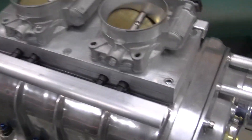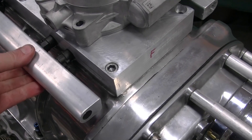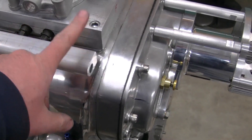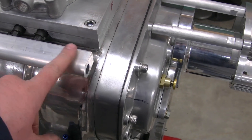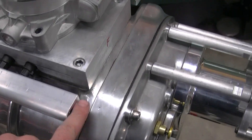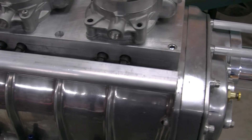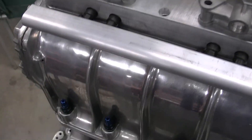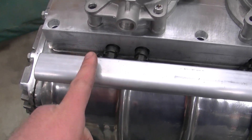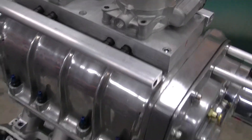There it is installed. I have not run anything to support the injector rails yet because I'm not 100% sure. When I get a car, I need to figure out exactly where these are going to sit and where I need to put my fuel lines going into it. I'll weld bungs onto either one end or both ends — I don't know if I'm going to do a crossover or not. I want to wait until I have a car in my possession before I figure out where I'm going to secure these.